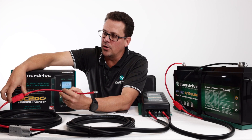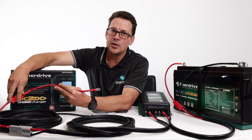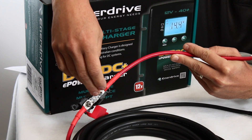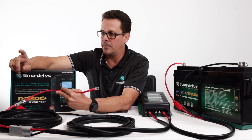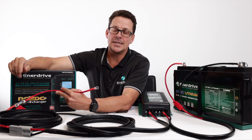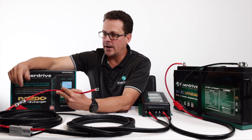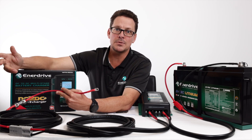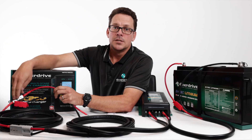On the DC-to-DC 40-plus 12-volt unit, we have a 70-amp fuse. This can be either a 70-amp fuse or a circuit breaker. One product we sell and recommend quite often is the 70-amp midi fuse. This can be replaced with a circuit breaker, however the one to avoid is auto-reset breakers. We've seen many service vehicles come in with issues where the DC-to-DC drops out completely, often traced back to auto-reset breakers. They de-rate in an under-bonnet application, trip out, and reset — so you may not be aware they've tripped until you get to the campsite and wonder why your battery isn't charged.